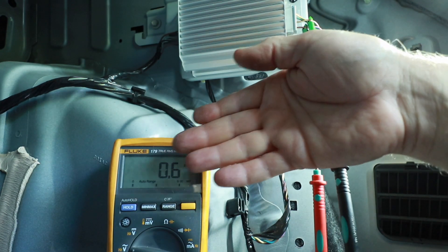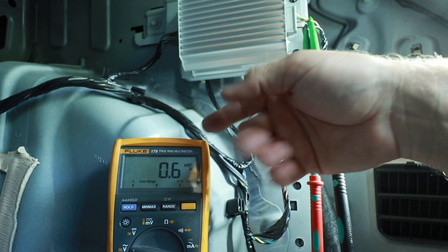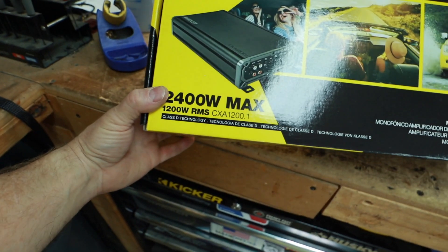We could try adjusting the signal from 40 to 50 to 60 to 70 hertz and see where this peaks out, but we know at that low a frequency we still have almost 10 volts of output. That means we need to check how much high level signal this amplifier will take. In this case - and this is a Kicker CXA 1200.1 - this amplifier will take 1 to 40 volts of input. Knowing that the high level input takes 1 to 40 volts, we're good. Even if we adjusted the frequency and it peaks at 15 volts or anything like that, that amplifier will take it. We have nothing to worry about on this one.